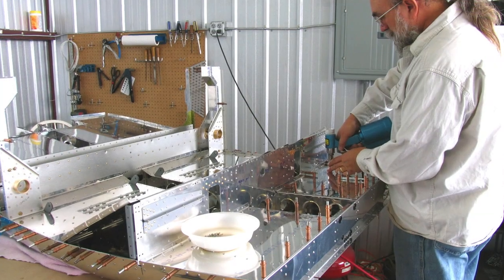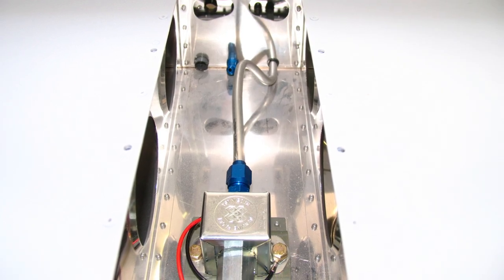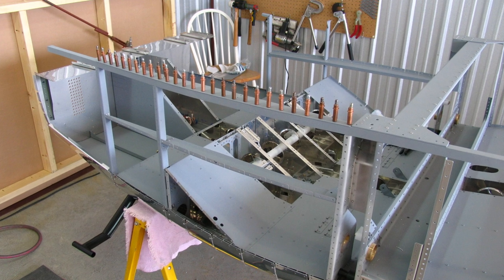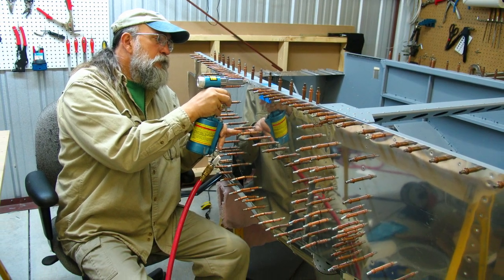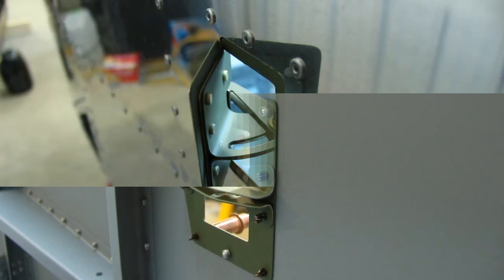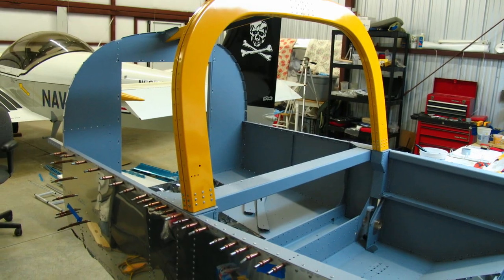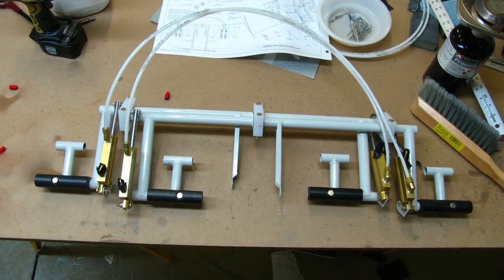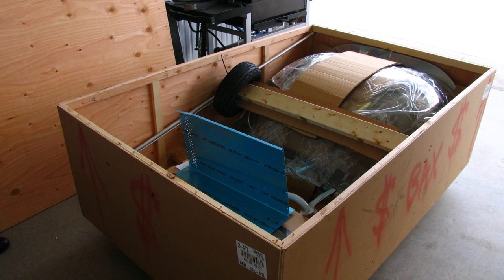Total time up to this point was a little over 220 hours of labor. Here is the fuel pump and fuel line assemblies. We primed most of the interior with self-etching primer, then attached the side skins to the center fuselage — lots of rivets. This is the air vent on the side of the fuselage. Here's the roll bar assembly — we primed it, painted it, then after we fit it up we took it off and repainted it. Working on the seat assembly and the rudder pedals and brake assembly.